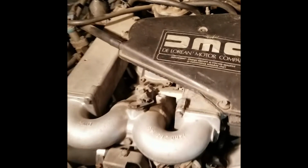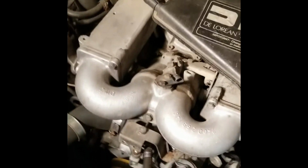And I noticed that every morning I'd have to fire up the car and basically jump on the throttle and rev it up to about 2000 RPM to get the alternator to kick on, which didn't interest me at all. So I upgraded to the Saturn alternator, which most auto parts stores stock, so it's just kind of another nice safety precaution.